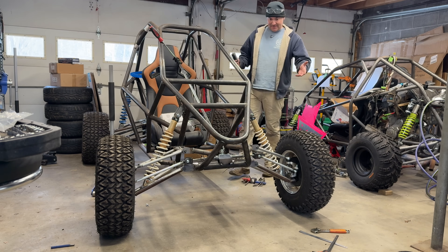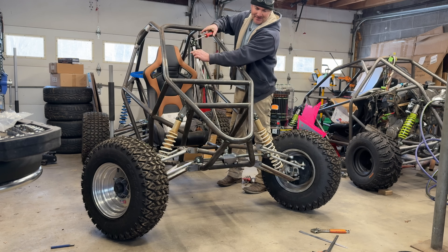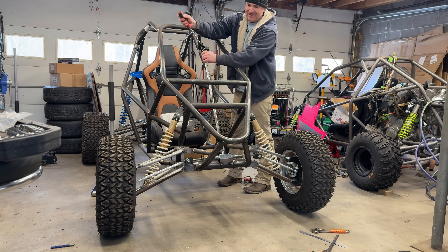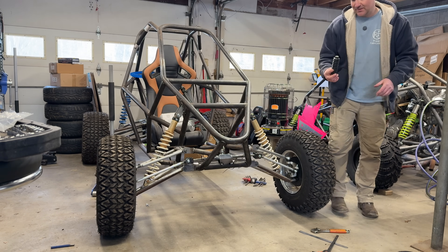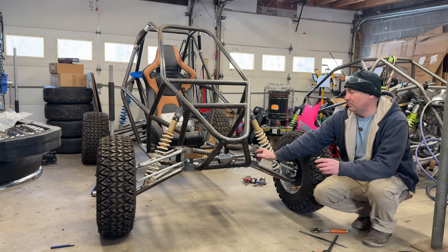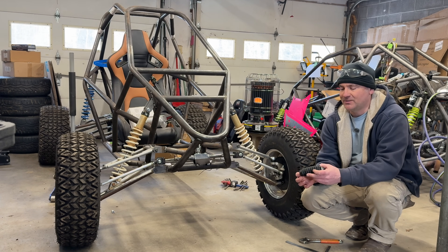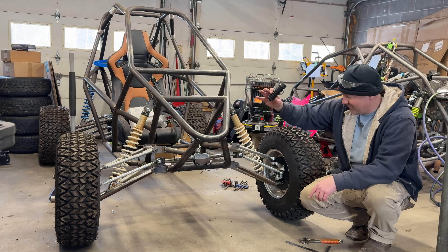Cross cart fans, that's it — super, super tough steering. Lots of radius and zero bump steer. One last thing: your rubber boots are for the three-eighths bolts, but we have half-inch bolts in there now, so you'll need to drill out the little aluminum keepers for half inch. It's super easy. Put your boots back on, put your zip ties back on — you've got an awesome front end. That easy.